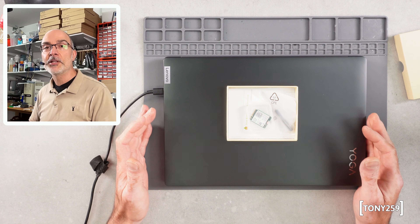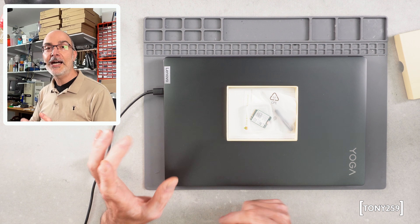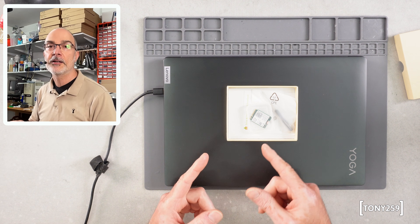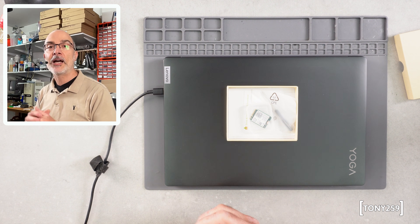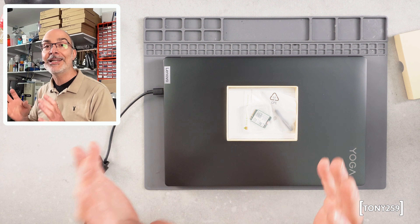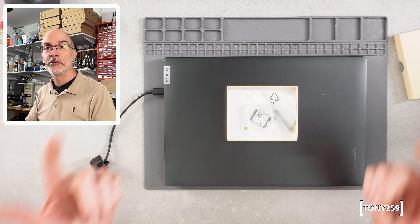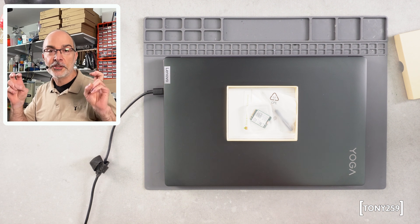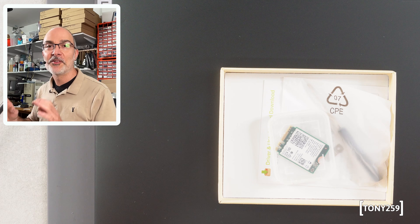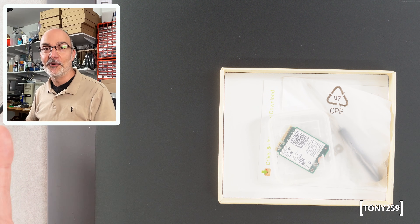And that's what we're going to do in this video — open the laptop, remove the MediaTek, and install this one. Little spoiler alert: I'm told that this laptop might not accept this Wi-Fi card. Apparently Lenovo have whitelisted only some specific interfaces in the BIOS itself, so the moment I replace it with something the BIOS doesn't recognize, it shouldn't even be able to detect it.